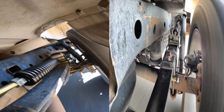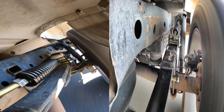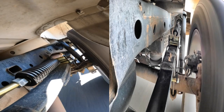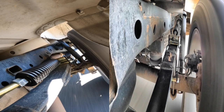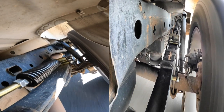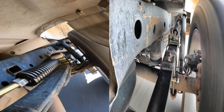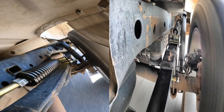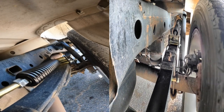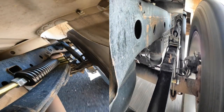We're going to compare the video footage between Sumo Springs and Roadmaster and see what we come up with. It's almost tied for how much squat you get. I could also put a spacer on the Sumo Spring to make it squat less, but I want some wheel travel — you need wheel travel for a comfortable ride. You don't want a rock-solid spring back there. Right now, I'm leaning towards the Roadmaster.